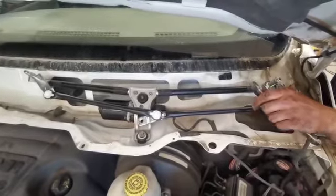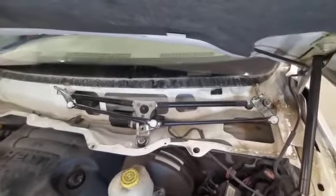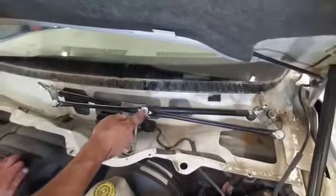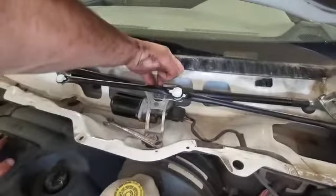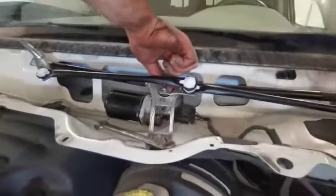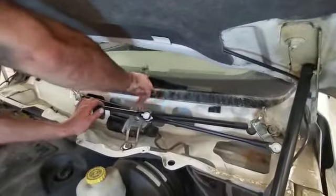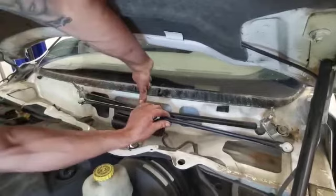The right way to line this up is to let your wiper motor cycle once and shut it off — now you know that's the resting position of your wiper motor. Then come with your linkage and put it exactly on a perfectly straight line with the motor and the linkage mechanism. You can feel the splines on the motor. Unfortunately you cannot tighten that up with anything other than a wrench. Once you get it on the right spline, go ahead and tighten it up with a wrench. The linkage may move on you by hand but that's okay, because the home position is the home position for the wiper motor.